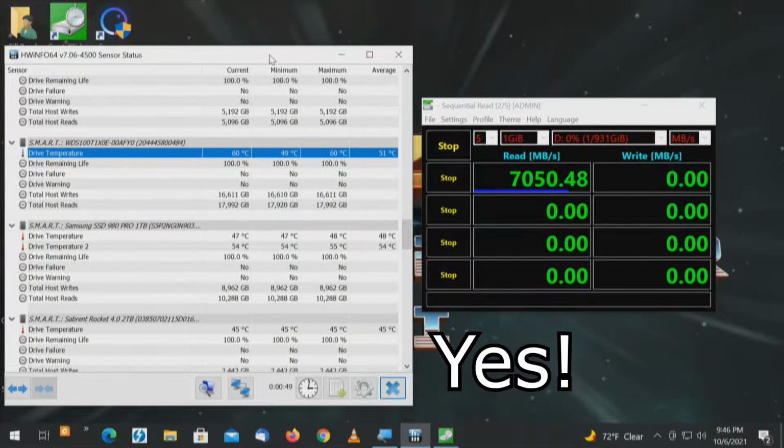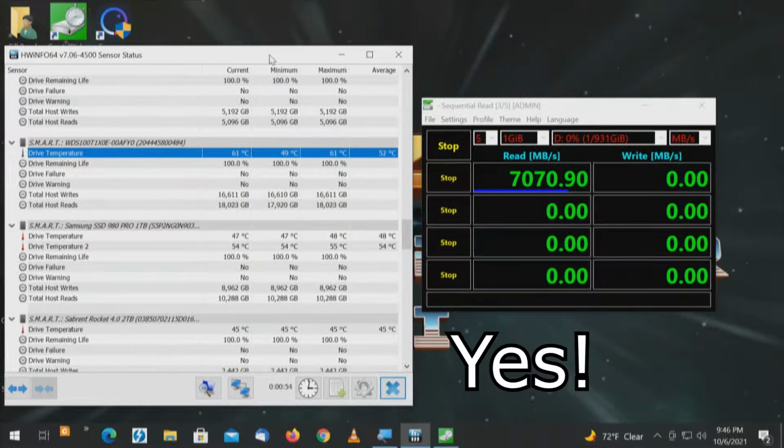Perfecto. Wow. I don't know about you, but that kind of freaked me out. Okay. So I think we learned a lesson there. Whenever you update firmware on an M.2 NVMe drive, power down, remove all power, drain those capacitors, power back up, check it and verify it.